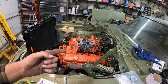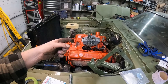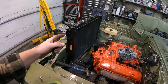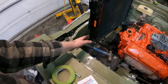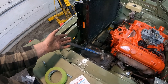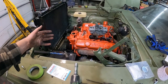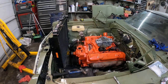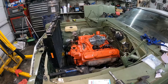I got the linkage on that came with the car. I don't know how I'm going to make that work. The carburetor does not fit this manifold — obviously it needs some sort of adapter. The radiator, which is like a C-body, doesn't quite fit, so I'm going to have to figure that out. I'm thinking if I just knock the battery tray in a little bit it'll sneak by. I got a list of stuff I need to buy tomorrow. I shouldn't have come out — I should have just left it with the motor in.